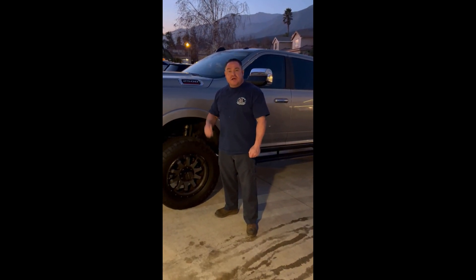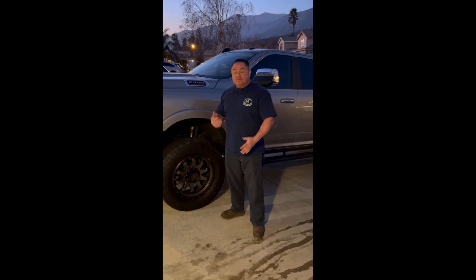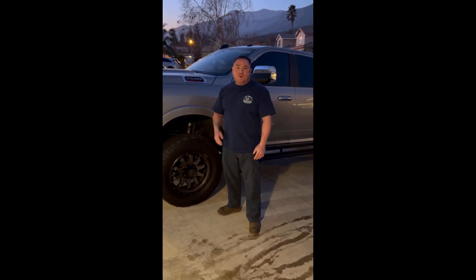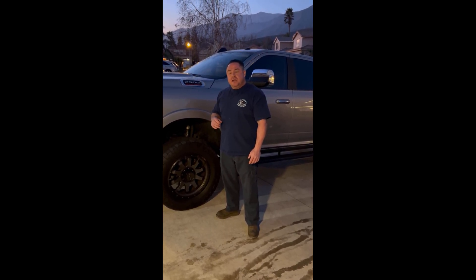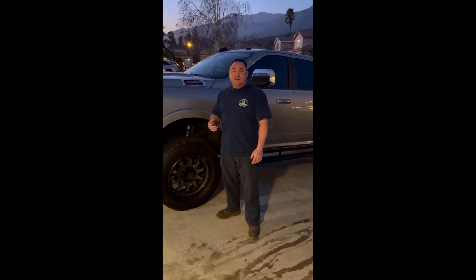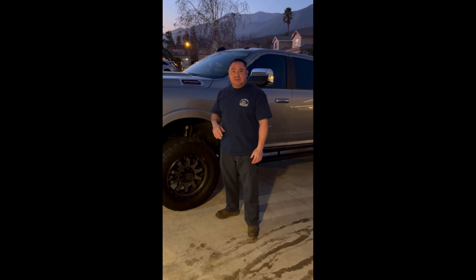Now that we've got the City Diesel turbo actuator in, I drove the truck about 30 miles and everything seems good. It did self-calibrate like they claim — the truck ran great. A couple things to remember when doing this job: you're going to need about four gallons of coolant, a 5mm Allen socket to remove the turbo actuator, a 7mm socket for the inner fender well, and a 21 or 22mm socket to remove the tires. If you follow the directions I've provided, I think you guys will be successful. I cleared my codes with the computer, but if you don't have one, places like AutoZone or NAPA will clear it for you. Hopefully you got something out of this — if you did, please like and subscribe. Take care.